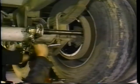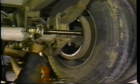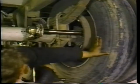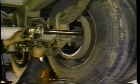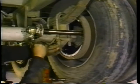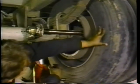Now adjust the brake linings to full contact with the drums. Back the brake adjustment off until the lining clears the drums. Maintaining this proper lining adjustment will keep the customer on the road and running for the life of the parts. That takes care of our S-Cam brake reassembly.